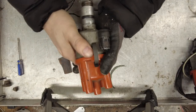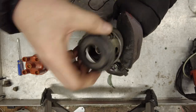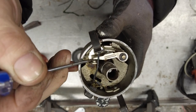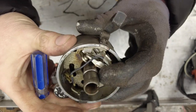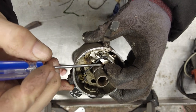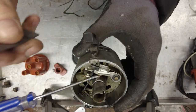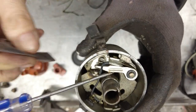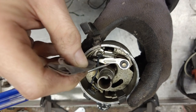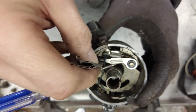Let's take our Dizzy apart. The particular one's a 009, but this is relevant for any distributor with points. We have our points — they open and close, with the breaker points at the end. On that breaker point you can actually get a buildup of residue, or in extreme cases the face of the contacts erodes away a little bit. So I'm going to wedge it open, use a little bit of fine emery paper, and give it a clean. If you can see any buildup on there, just gently clean that residue away so it maintains a good spark and an even gap.